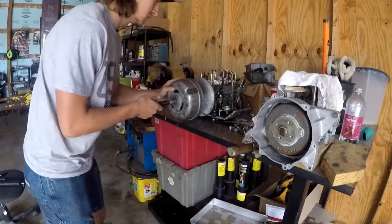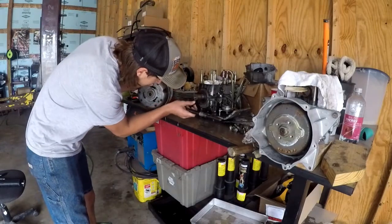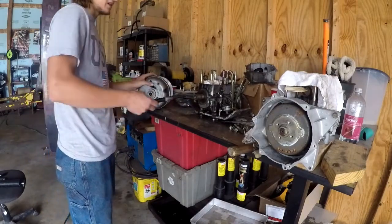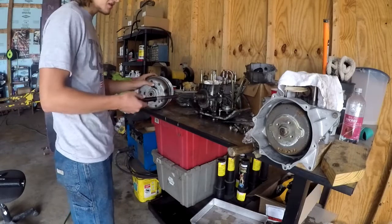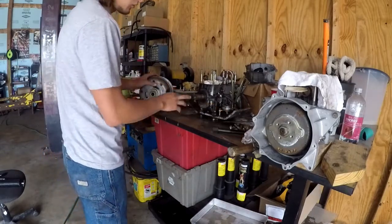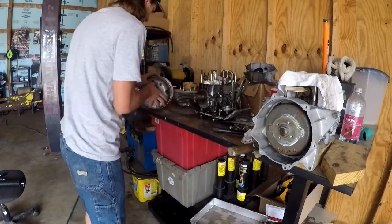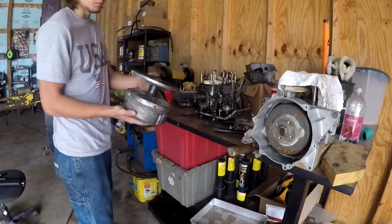Air compressor is built up - we'll try to get this thing off. Put her on, tighten it down, and there she is! Unthread the puller - there it is, worked pretty slick. The grease kind of acts as a barrier because you can't compress grease, so it gives you a little extra cushion at the end. That way you won't mushroom the threads up as much either.